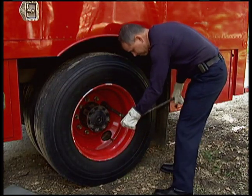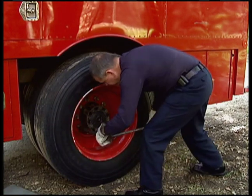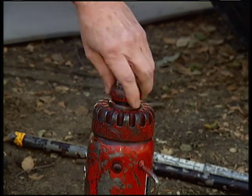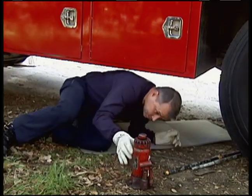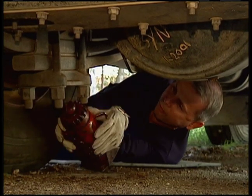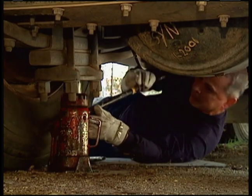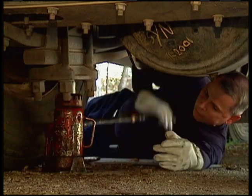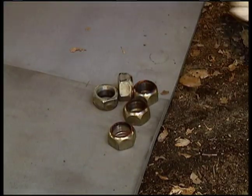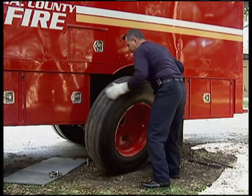Prior to raising the vehicle, use the socket end of the lug wrench to loosen the outer lug nuts approximately one turn. On a double nut wheel securing system, the passenger side loosens counterclockwise and the driver side loosens clockwise. To save time and effort, raise the jack close to the height needed before placing under the vehicle. Consult the vehicle's operating instructions for specific jack placement; if no instructions are found, place the jack below a smooth, flat surface under the axle nearest the damaged tire. Raise vehicle until the tires are approximately two inches off the ground. Finish removing outer lug nuts and place them all together for easy retrieval. Remove the outer tire and lay safely on the ground; do not lean the tire against the vehicle.